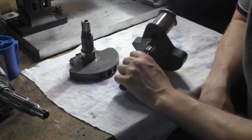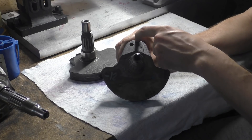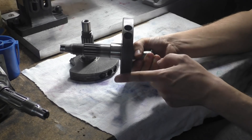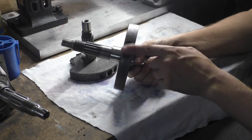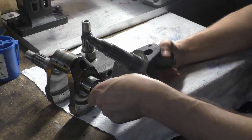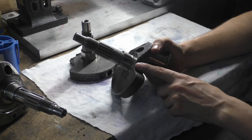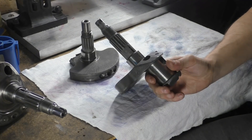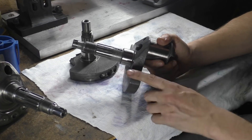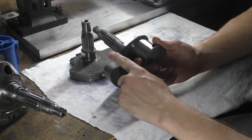Right, where were we? Right then. You can tell by the parting line — it seems like quite a wide one to me, but usually it's quite thin compared to the forged ones. Another way you can tell is that this has been machined after the fact very roughly — it's just a skim cut to get a full circle. Another way you can tell the difference between forgings and castings: one of the ways is that this has an abrupt 45-to-90-degree edge — you can see this basically just ends. It comes down and stops, so there's a perpendicularity there.